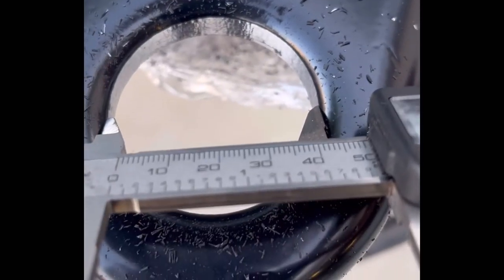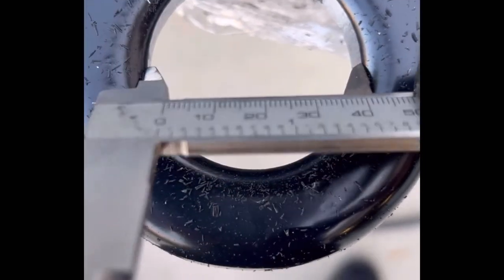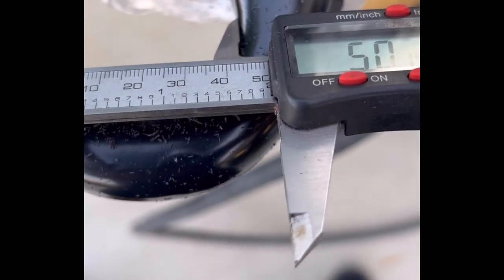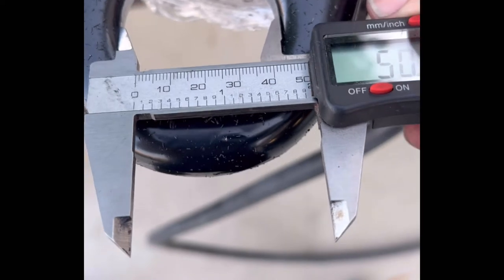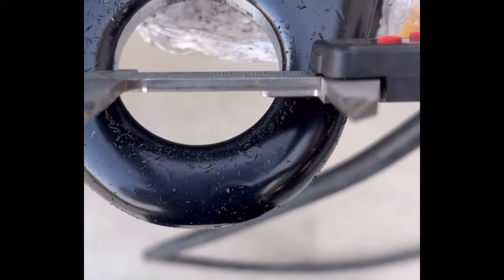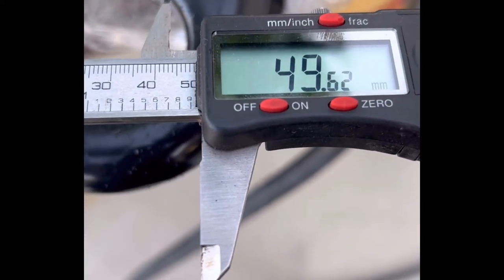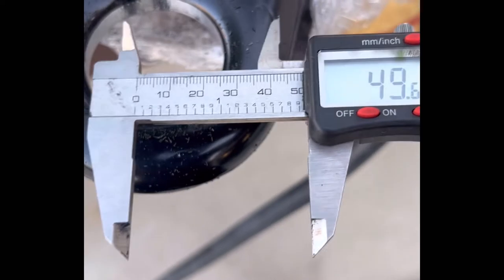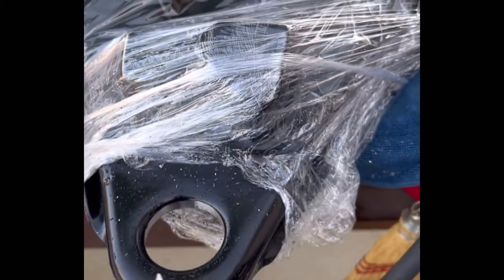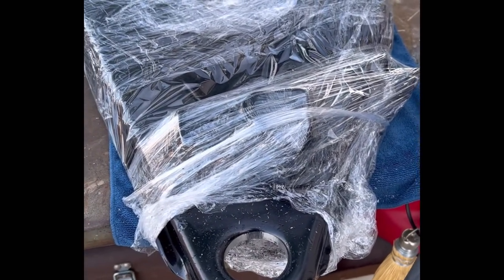It needs a little bit more so I'm gonna repeat the process — need a couple more millimeters to be able to fit the ball joint in there. It has to be kind of precise because it's pressed in. Measuring now — 49mm. It does have a beveled edge so maybe I'll just leave it like that. The top ones are gonna need a lot more, these bottom ones just a tad. That's all in order to get this brake setup working.